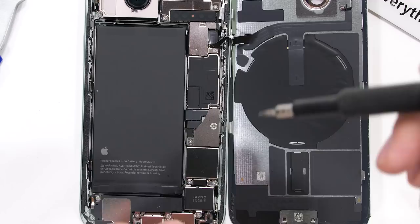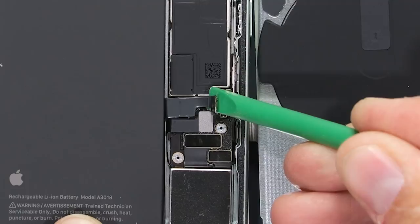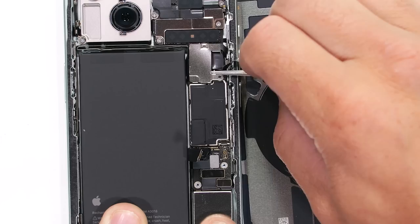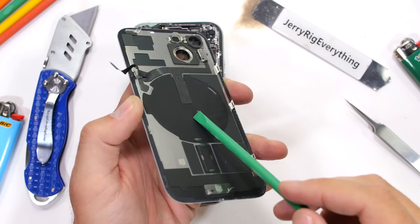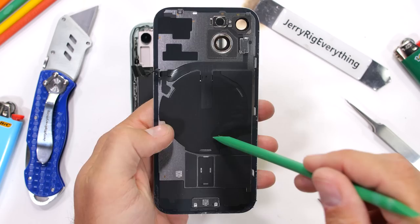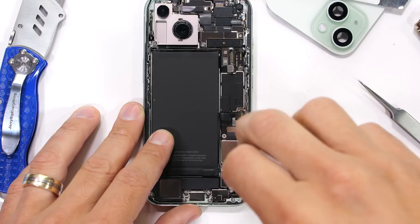I'll switch to our second screwdriver bit to remove two tri-point screws over the battery ribbon. It's got the plus and minus etched into the top and can be popped off like a little Lego. There's another metal bracket held down with a singular tri-point screw, and if you slide the bracket down it comes off a lot easier. I'll unplug the rest of the back glass panel with its copper wireless charging pad in the center. At the moment, Apple charges $169 to replace this whole component. You can buy imitation glass panels for around $20 off Amazon or eBay, but a glass-only panel is not really worth the effort — it's nearly impossible for a first timer to reuse Apple's original metal frame.